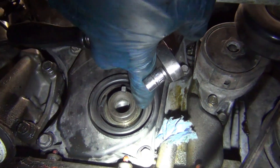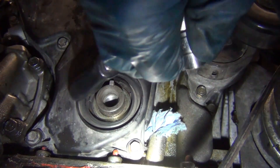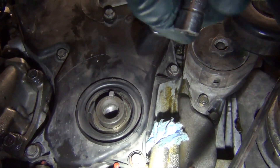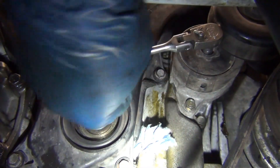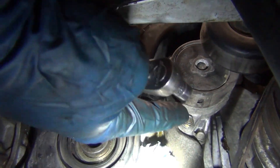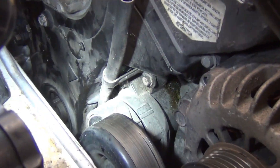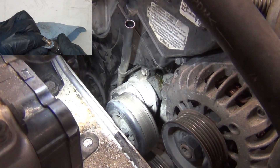There's a metal plate that holds the timing belt on — it has marks showing which side has teeth and which side faces out. It has to go between the cover and the belt, and eventually the harmonic balancer pins that plate down to help hold the timing belt. For the dipstick tube bolt, I take the bolt and put it in a paper towel to hold it in place while I drive it home into the hole. The 8 millimeter bolt for the idler pulley can be accessed with a quarter-inch drive, and there are 10 millimeter bolts above and below.